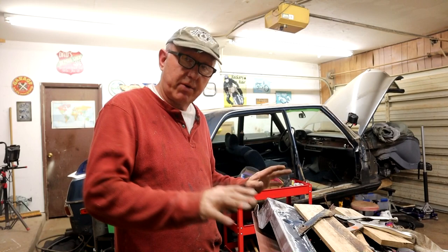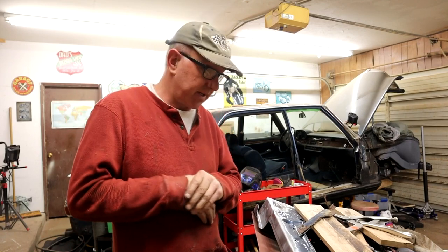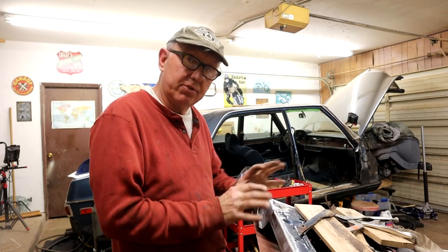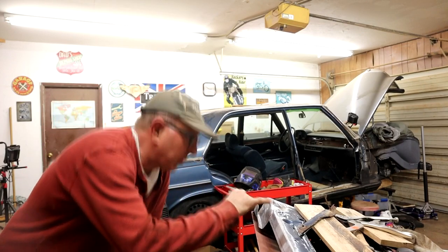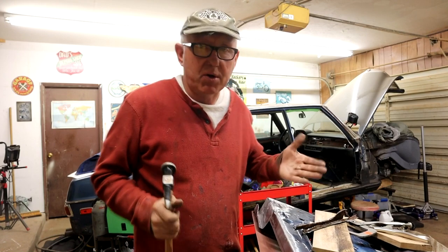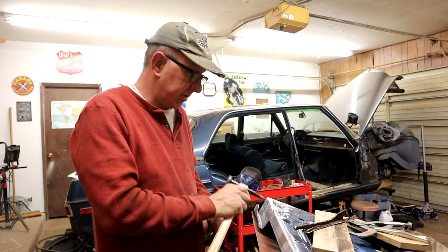Okay, so this is part one of welding the door up. I thought I was going to do it all in one, but certainly not. There's too much to cover, and hope you don't mind these videos taking a little longer than I was expecting. I just like to cover all the things I bump into. So this went pretty well. This one, the second one, to make sure it was orientated correctly, was the tricky one. I've got a little bit of a raised point there, which I think I can take down with the old planishing hammer. Just gently tap that down. This is behind the panel, so it's not crucial or anything. And obviously if you're doing a shorter door, you wouldn't be having this, just this one and then this one.